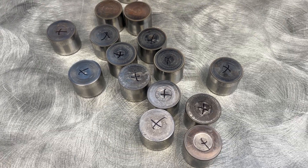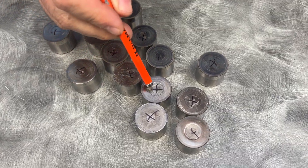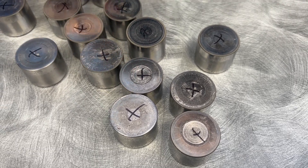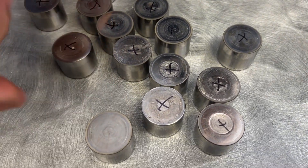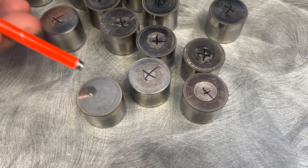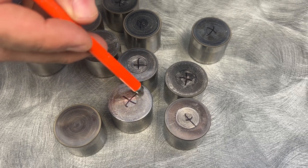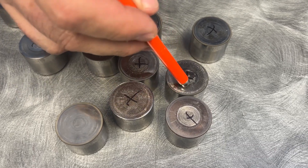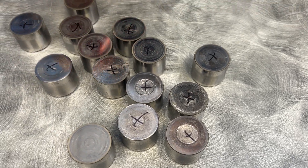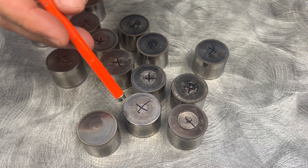The buckets have a little damage. You can see some of them are really, really beat — and this is only on the exhaust side. Here's one of the intakes — very clean, really nothing. You can run something across it and you don't hear anything. On the exhaust — you guys hear that? You can see it too; it's pitting right in. That's a really rough deal because we're using a GSC S2 cam.